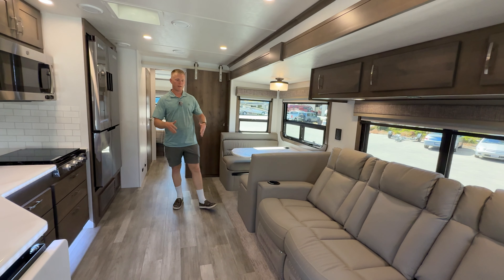Up front here you can tell this is the M2 106 chassis - that's a real truck chassis. You can tell because you can see the fuel tanks right here. If this were an RV chassis it would have a fuel tank in the rear, but this is a real truck chassis which gives you a heavier-duty frame. You've got saddlebag tanks - 50 gallons each on both sides up front - along with the DEF fill point and a block heater right here.